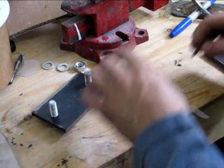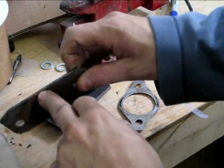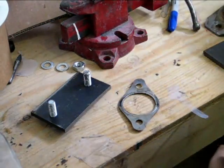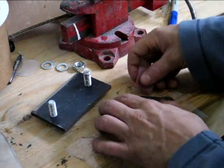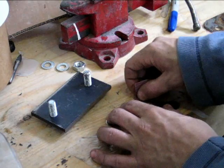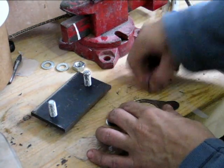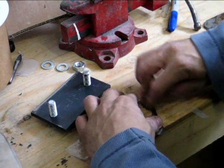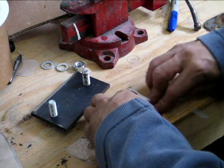Just that the other plate was not... It was only hitting the edges, so maybe if it had been a little bit taller, it would have worked, but even there I can see there's a curve in the metal also. Probably not thick enough. Anyway, if you look up the EGR delete kits, I guess they use 3/8 aluminium. So a quarter inch steel should be good.